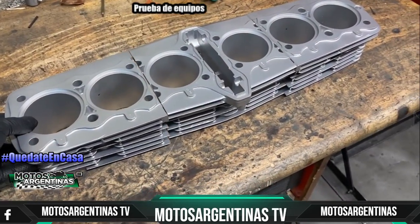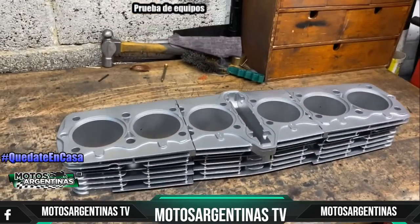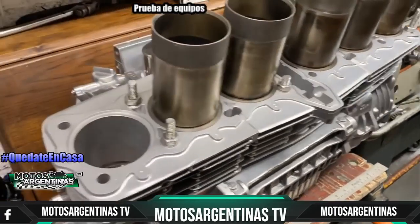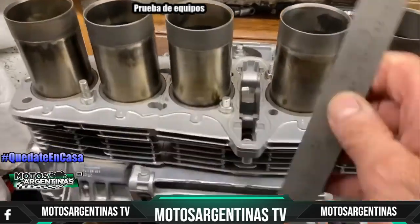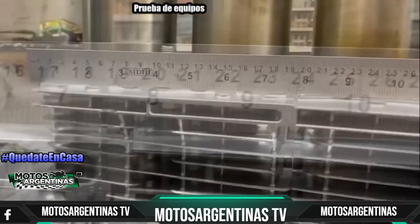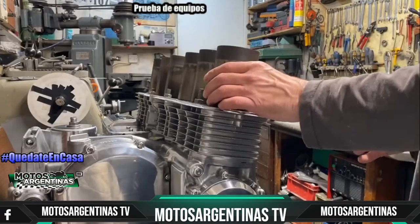Then I had the barrels media blasted so they're all clean, ready for welding. And before I could weld them, I had to bolt them onto the crankcases of my engine to hold them in the right place. Then I put all the liners upside down in the recess on the barrels, and using a rule, I made sure they're all in line and the barrels were sitting flat on the crankcases. When I was happy, I removed all the liners and tightened up the head bolts tight.